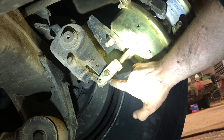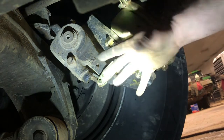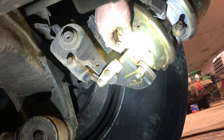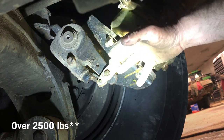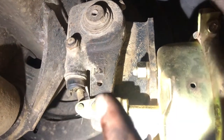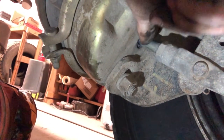When you hit the foot brake it'll go quite a bit harder. With the diaphragm and all that air pressure — pi times the radius of the pancake in there, times the pressure (probably 90 PSI), let's say 10 square inches — that's 900 pounds of pushing force. You can see it's at 90 with the parking brake set. Release it and it should be at 110 degrees. Look back at this — it's not quite the same distance but pretty close, and you can see the rod kind of going up.